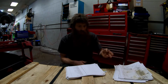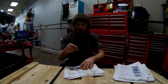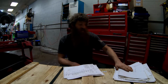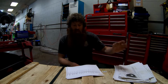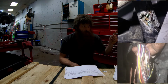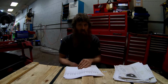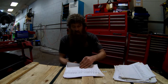Just a nightmare. So, I start looking at it again and 9 volts coming out of the VREF circuit from the computer. Cut the wire, I see 9 volts coming out of the VREF circuit. So I sent it back to the dealer. They ended up spending, I guess, 4 hours on it, charging us only for an hour, and found the messed up harness right on the core support. There's a picture of the wires. I know it's not the best picture, but that's what the wires look like. And just awful. I just don't understand how a smoothly rounded core support could cause this type of damage. It makes no sense, but if it saves you guys time in the future, it's good with me.